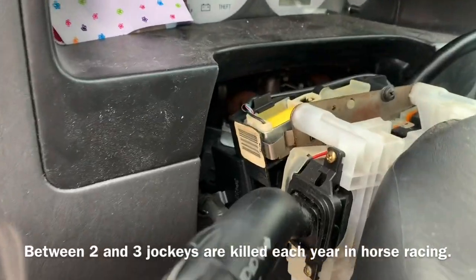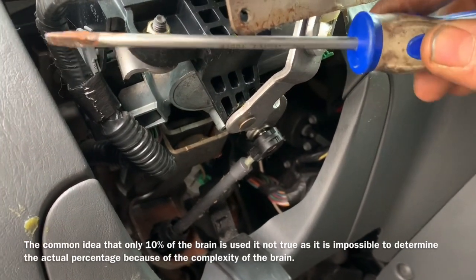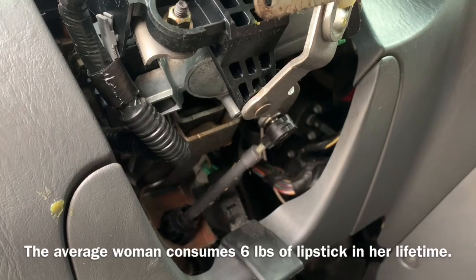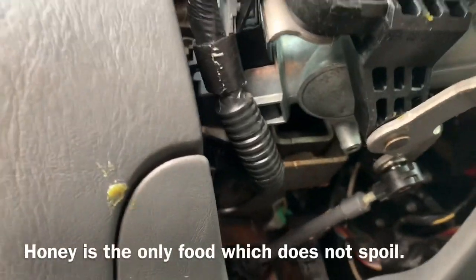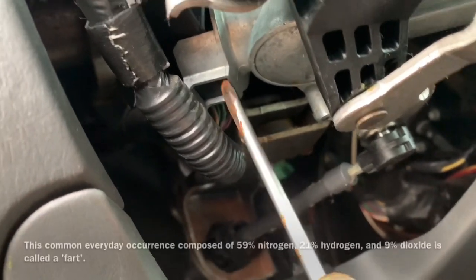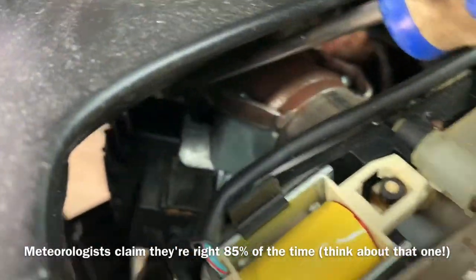Say for whatever reason you want to get this vehicle to start and the ignition is not turning — right up underneath here on the steering column is the electrical portion of the ignition. When you stick your key in and turn it, it activates the electrical portion. We're going to remove that electrical portion, stick our key in so the passlock works, and see if we can get the vehicle to start before we replace the steering column. On the bottom of the electrical portion of the ignition there's a little clip held inside this box — push that out with a flathead screwdriver. There's still another one directly above it, so we need to release that one too to pull off the electrical portion. The top one is right down inside there — you can barely see it.